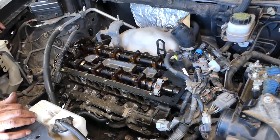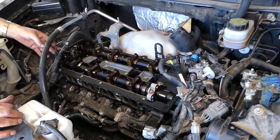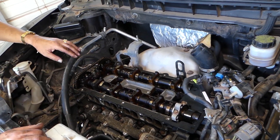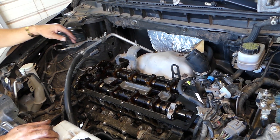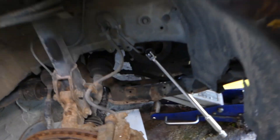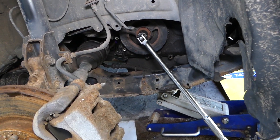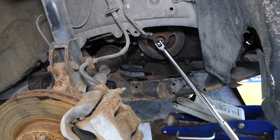You need to install that pin and you'll know the engine is at top dead center. If you're not putting in timing chains or anything like that but just need to bring it to top dead center — to check timing or something else — you don't even have to remove the valve cover. Just use that pin and you can check top dead center like that. Hopefully this video will be helpful. Please hit that subscribe button for more videos, and see you next time.